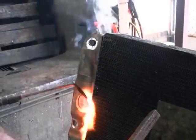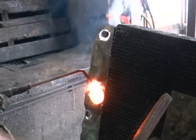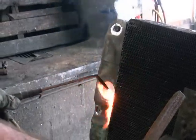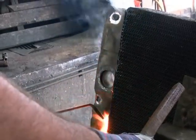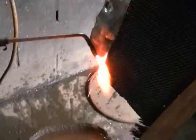Getting back to stripping the tank again, we just gently heat both surfaces, taking into account all the moisture in the radiator. You can see the steam coming out — there's a considerable amount of water still in there. Sweating the solder from the crank hole, being careful: too much heat and no brass left. You're dealing with 80, 90 year old brass and it can burn easily.